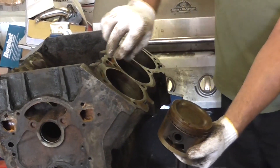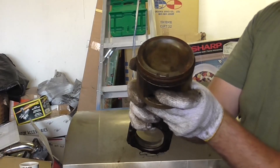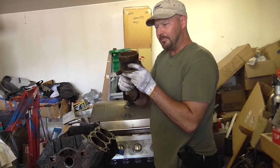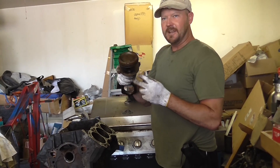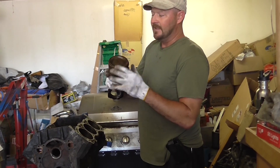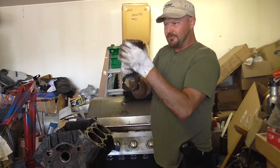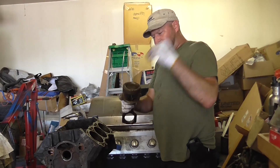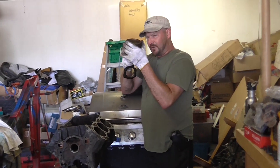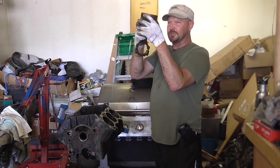This is the top of the piston — it's a dished piston. See the recess inside? This is a dished piston, good for extra room for boost. Dished pistons are best for turbocharged applications or low compression applications. If you want to run an engine on low octane fuel, having this extra room lowers the compression. Having a dished piston is very advantageous for a turbo engine — it gives you room for all that boost, so on your intake stroke you get lots of boosted air drawn in and forced in, with all that extra room in the piston for the extra displacement to be stored, compressed, and when the fuel-air mixture and spark hit — explosion.